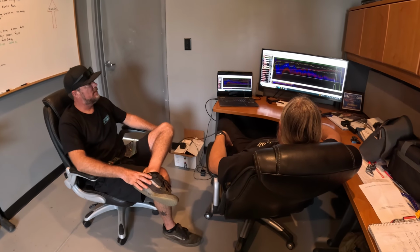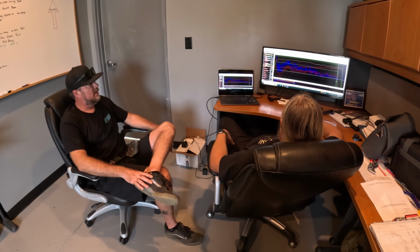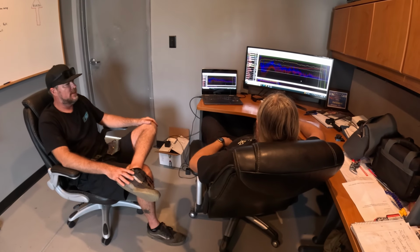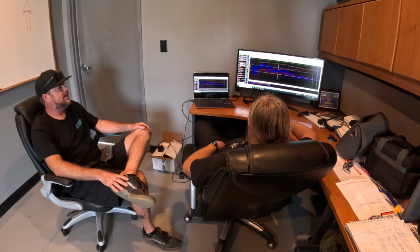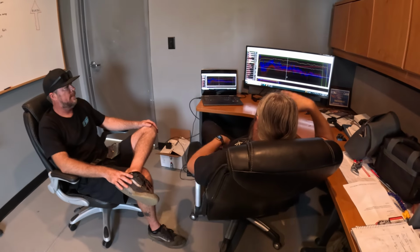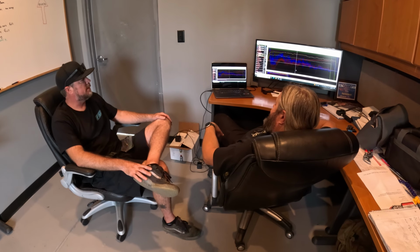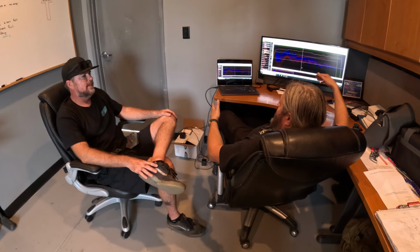So the question is, what do we do first? I kind of think you want to put sticky stuff on the tires, trim the air fuel, and hit it one more time. I would love to see 1,000 at the tires. I'm going to trim the fuel out to get it closer. Maybe we'll put it at 6.8 and just see what happens. I'm just going to barely miss the tires. I don't want to skew our results here.